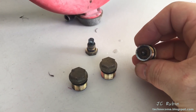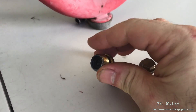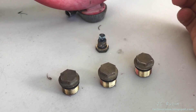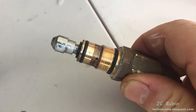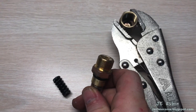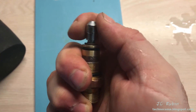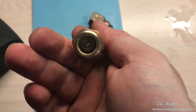Quick inspections of these show some of them to be in better condition than others, but nothing absolutely horrible. I don't see any horror shows here. There's a drain one on the lower one. Now I'm just going to keep moving along with this disassembly. This is supposed to move — it's supposed to be a spring-loaded item, so I'm going to have to have a further inspection. It breaks down even further with this spring and a little piece in here. We're going to flush it, then oil it. We see that everything is moving just fine inside.